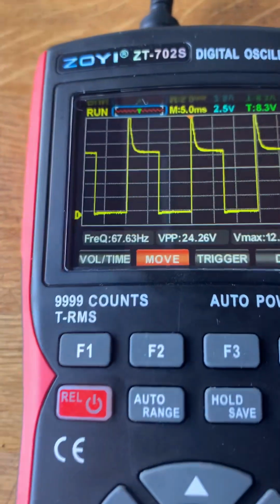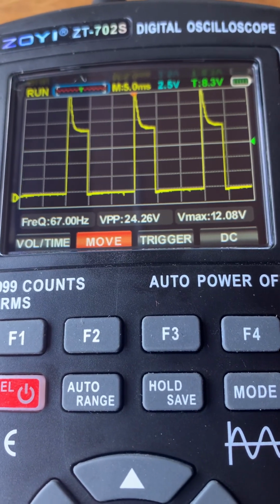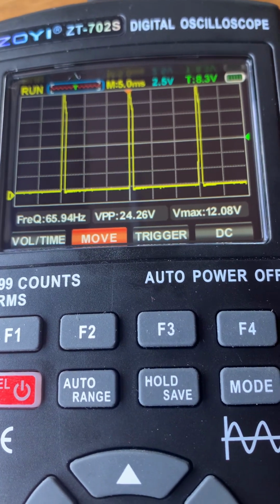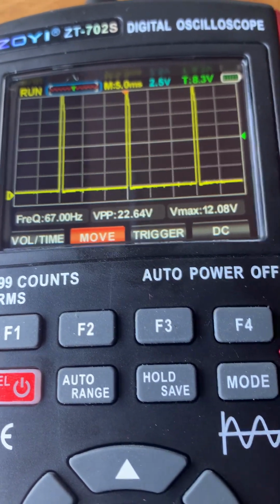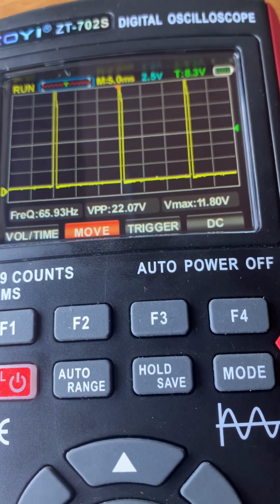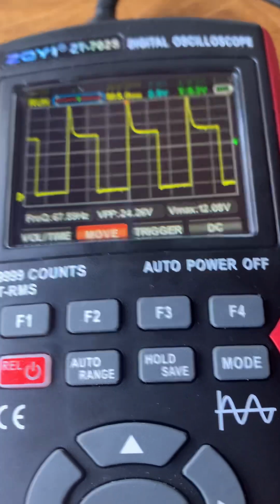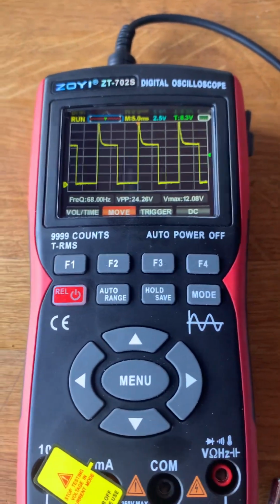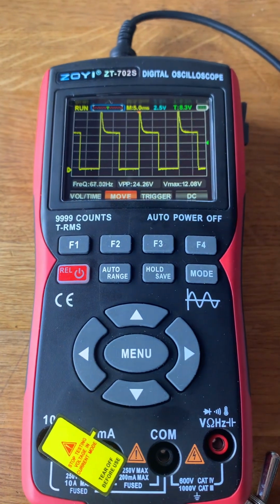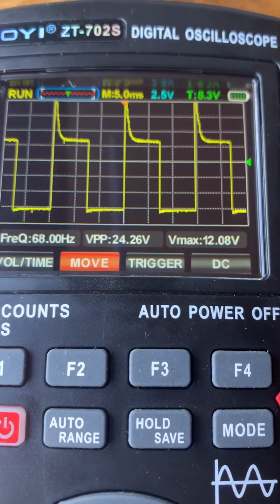Let's play around with that a bit more. So that's grounding the sensor. I'm grounding, so it's going to full rich. And that's standard default. So that's the visual interpretation of what you're doing when you're setting the dwell. All you're doing is looking for basically the mark space ratio.